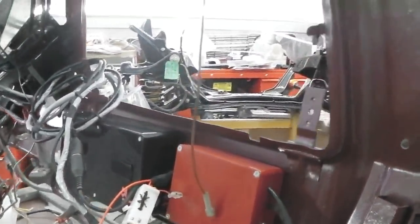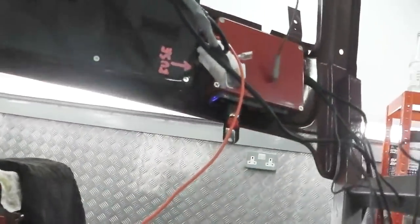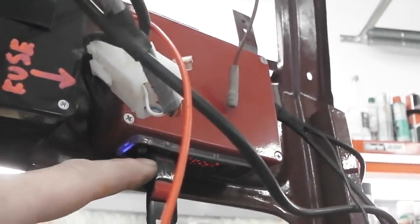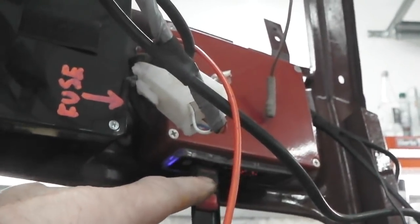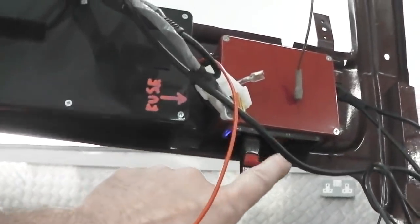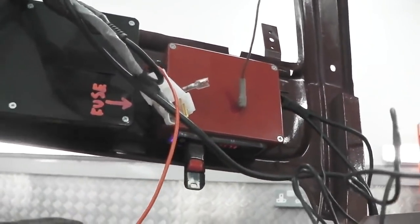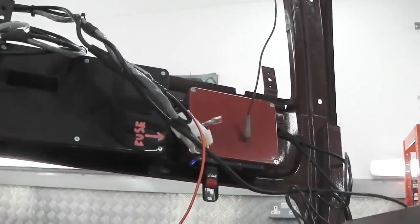This is designed so that the MP3 indicator display is visible by sticking your head in the footwell and looking up at the display. You see, that USB stick that's sticking down, I have a right angle USB plug connector here, an extension lead, and it comes down this little slot and goes to the steering column, so that you can push your stick into the steering column as opposed to having to go underneath. However, on the second slot there's a micro SD card, which you can get, but the idea of the micro one is that all your desert island records are on that, and you shove it in and forget about it.